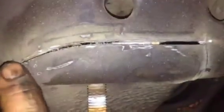Okay, so I've cut all the way down there, all the way down to there, and around the side, down there. See that cut? It's a nice fine cut. Be a nice neat weld when it goes back together. What I've got to do now is heat this line up here, because I don't want to cut the whole thing out and make it too weak. I'll heat this line up here now and bend this out of the way, and then hopefully we can get to our fault.